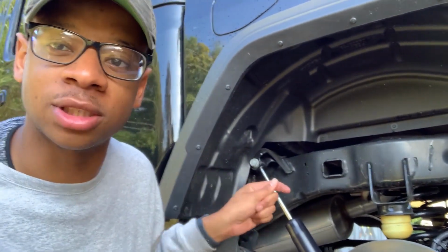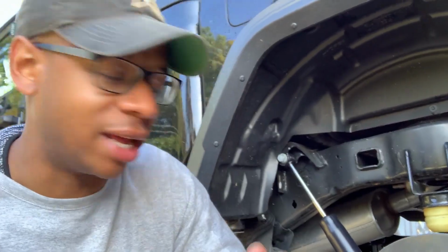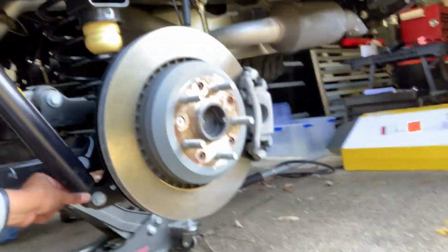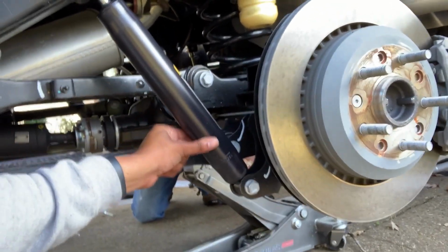And as you cut the strap, the spring is gonna slowly expand, but it gives you just enough time to move it as it's expanded into this bolt hole right here, and then line it up. If you pass that bolt hole, then you're just gonna have to work on getting it retracted or get it collapsed to get it back in that hole, but it moves relatively slow. So if I can do it, you can do it too.